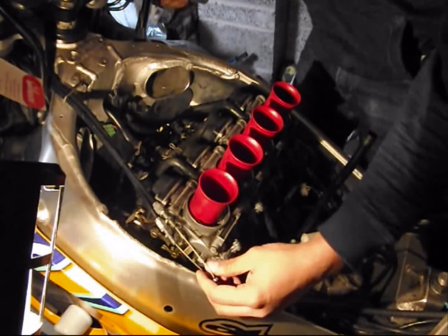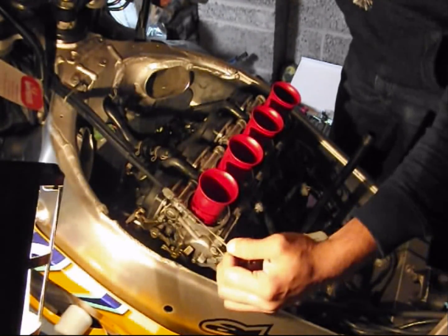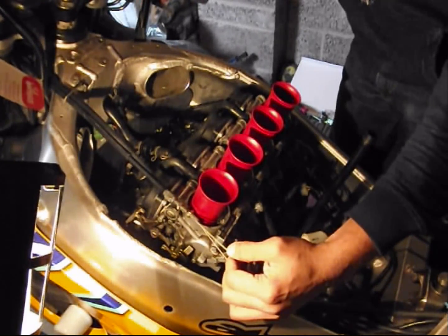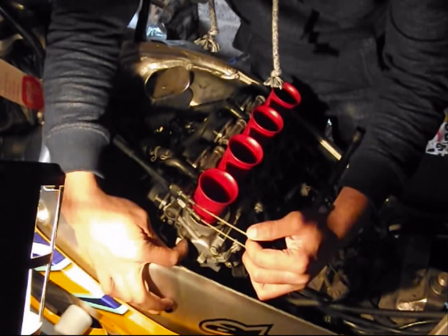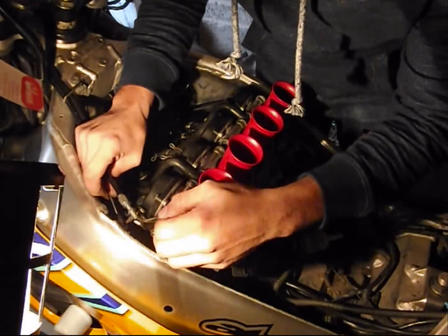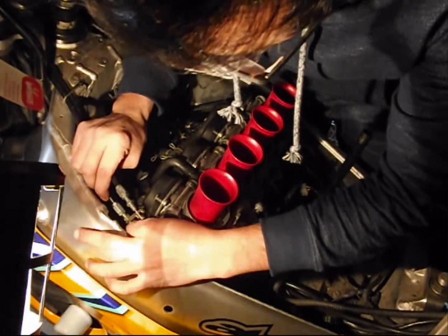So we first check which one is a pull and which is a push. The top one, when I rotate, is pulling. The other one is a return. The throttle works in the same way. So the pull goes on the top and the return goes at the bottom.